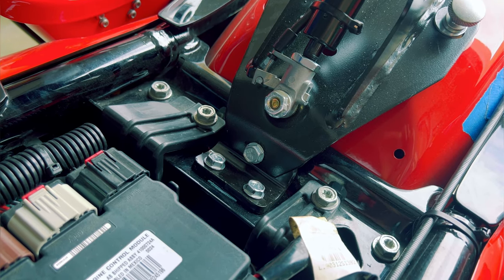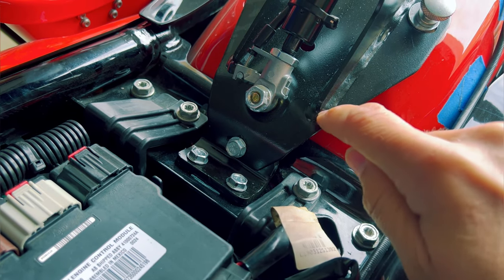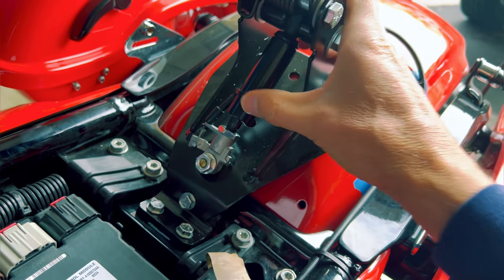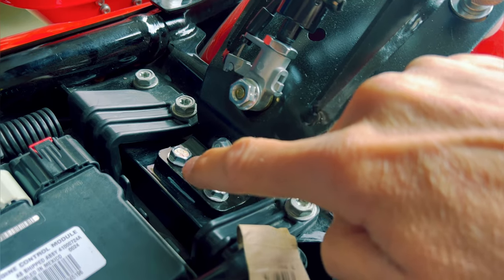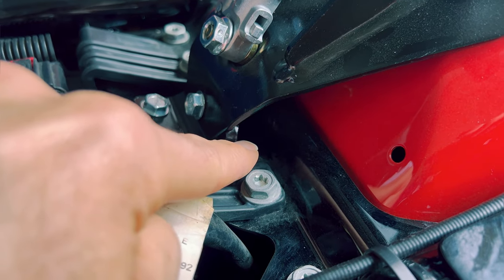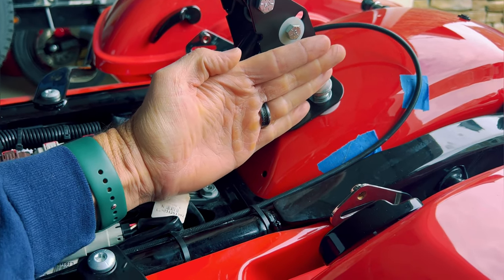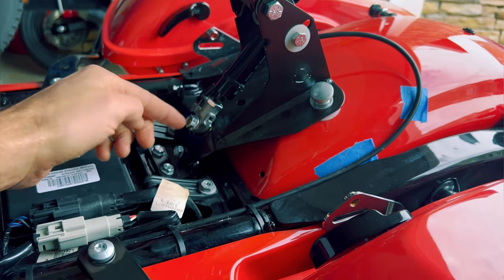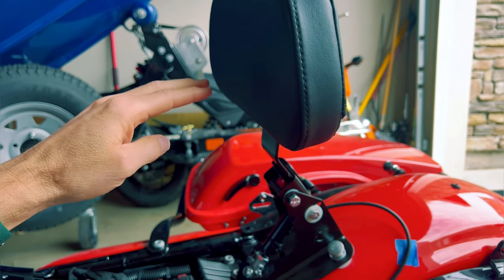They're going to be covering it up so nobody's ever going to see it. Once I drilled this hole out in this bracket, the bottom bracket is still loosely mounted to the bike — I never touched it. Just this main piece: take it off, elongate the hole. Allow this bracket to overlap the front. What this does is when the bracket goes in front versus behind, it changes the bracket from being mounted on the bike flat to coming up. Now when the nose of this bracket comes up, that means your backrest is also going to come up.